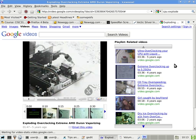Okay, and then I cleaned out the dust and it stopped. So you don't think there might have been that much damage? I don't think there's any damage. It's really just the software. This is called throttling. Most modern processors can do throttling, and it is more common with laptop computers to conserve battery power. But with a desktop computer, the processor is capable of throttling as well. In this case, it's a thermally triggered throttling to say that I'm running too hot. I need to slow down so I don't kill myself.